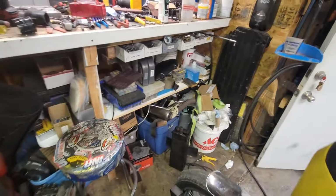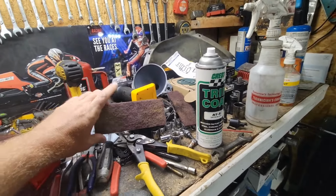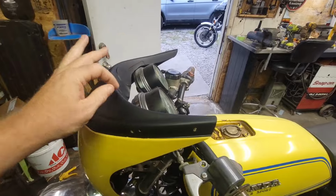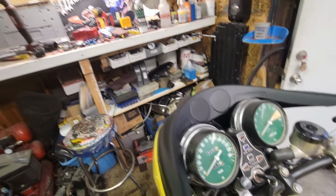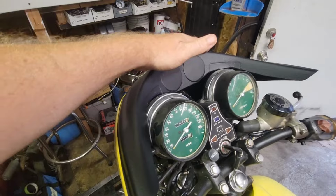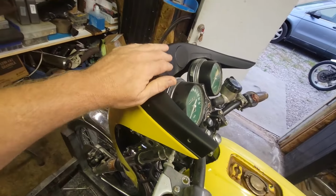It looks a little different. It got a little treatment. A little bit of, as you guys know, my T-coat. You see there's the yellow. I went ahead and roughed that up, and hit it with the T-coat. I love using the trim coat. I call it T-coat. It's AT2 satin black. It's got just enough satin to where it has a beautiful shine or a semi-gloss, but yet it still is a matte finish. That's really what I wanted up here.